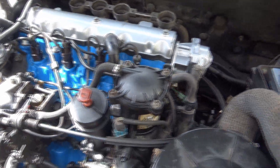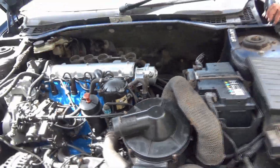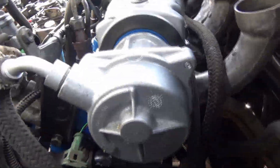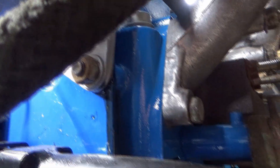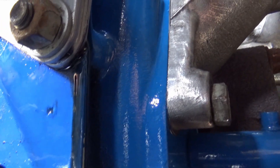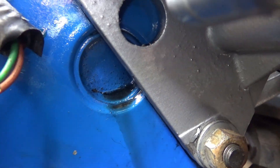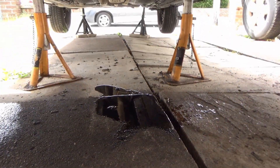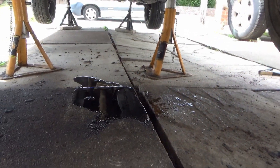There is one major drawback I've noticed, and I knew there'd be some teething issues. I'm going to end this video here until I can get a couple of o-rings. Looking at the bottom of the vacuum pump — there is an oil leak. It's hard to tell because it's brand new clean oil, but there is an oil leak coming from the vacuum pump. It had new o-rings and new seals but it obviously didn't like that. I'll need to have the vacuum pump removed, new o-rings fitted, and find out what's going on, because it's leaking quite badly — there's a puddle on my driveway. There's also a little oil leakage from the oil filter which I've just sorted.